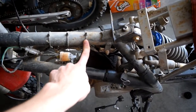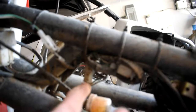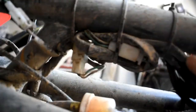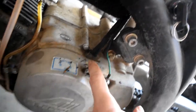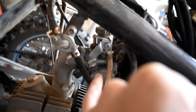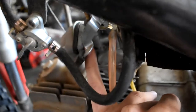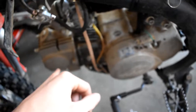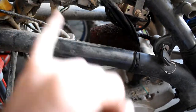So now we got a better view of what I was talking about originally — these zip ties and this control module. Realistically I don't think you'd be able to get in to maybe the middle zip tie, but from what I remember you could only see one. There's even a third one up here holding all these control pieces, but we're gonna have to get in there and unplug these so that this electrical piece can come out. Before I get into the wiring stuff and have it dangling down everywhere, I'm gonna go ahead and pull the carb off of these bolts. I've got to pull these two bolts out to get the carb off because I can't leave the throttle cable attached — I can't pull the engine out if the throttle cable is attached to the carb and the carb is attached to the bike.